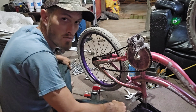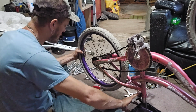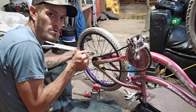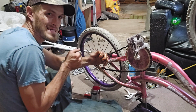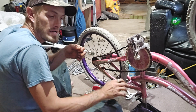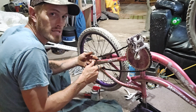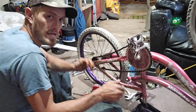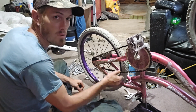See, when I used to make them when I was a lot younger, I used to put my foot down here, grab a hold here, pull, make sure the tire's straight while I'm pulling. And then I reach up, tighten one down with my hand, just kind of snug it up, switch hands, tighten the other one up, grab a wrench, pull it tight, and then of course switch hands again just to make sure it stays straight, tighten it down, then let go, and then just go cranking on it. Never had to worry about chain popping off.